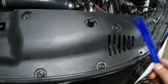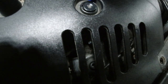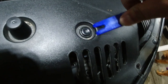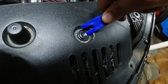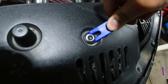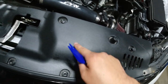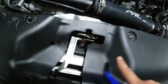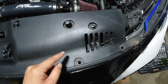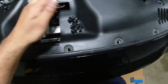Basically what I do is grab one of these little prying tools. You see how there's like little gaps right there? You're just gonna go in like this without breaking the clips — if you do break it, it's fine, these are easily replaceable and fairly cheap. Pop it out like that. There should be 1, 2, 3, 4, 5, 6, 7, 8, 9 — so 9 of them. Once they're all loose, if it hasn't popped off completely just pull it off with your hand, then set it to the side.